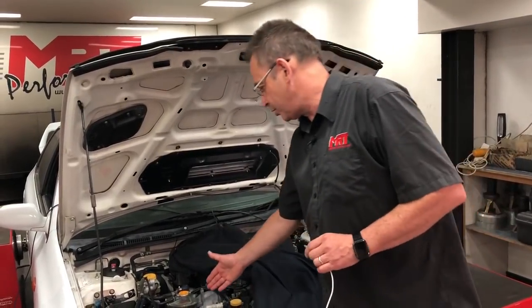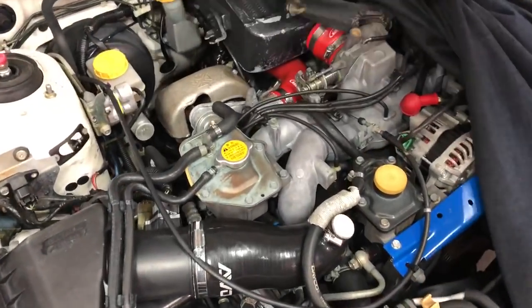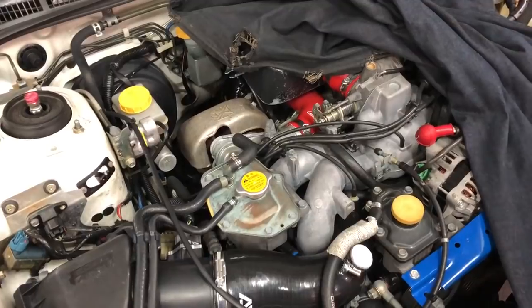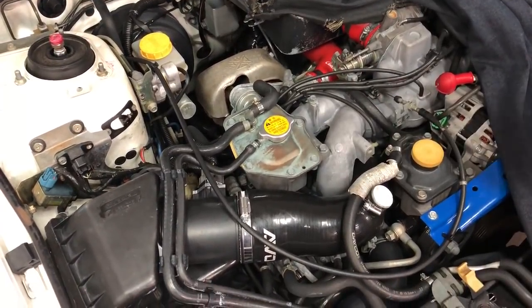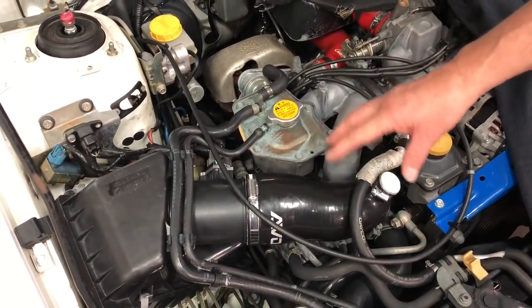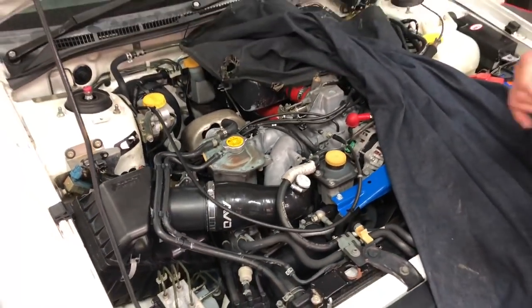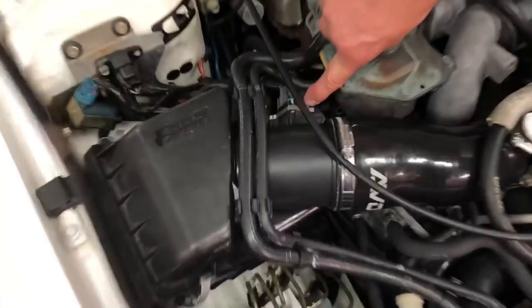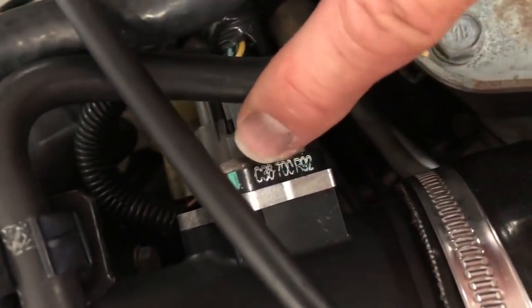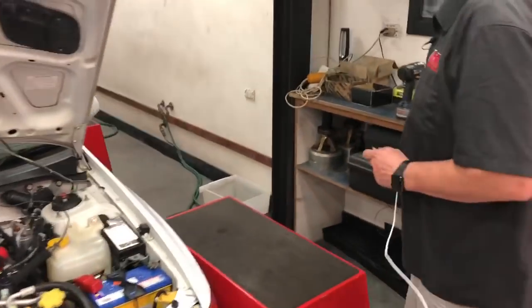The engine had a bit of a birthday by the previous owner before the client bought it, going back to the original factory turbo. We've now put an STI turbo back on it and fitted it with a silicone intake — on these early models the rubber intake is starting to get a bit tired, so a silicone intake is a good idea to check on your particular model. We've also put a brand new airflow meter sensor in — you can tell it's new by the clearly identifiable green mark on the top and the white numbers on the side.